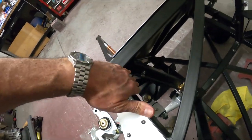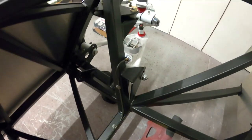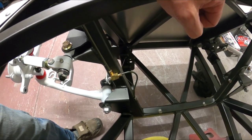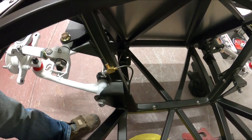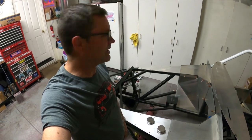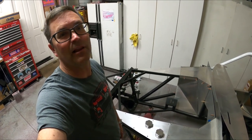Coming in at the same location, using this adapter on this side — this is the rear of the car — doing a little loop down and across, same thing on the other side. Many guys on the forum have done it this way. I was working with my son this weekend and wasn't concentrating fully, but tonight I thought it through and realized that wasn't the right way. No harm, no foul — just a bit of extra work. It does look better, very clean. Thanks to the guys on the forum, and thanks for watching this episode of the front brake line screw-up.